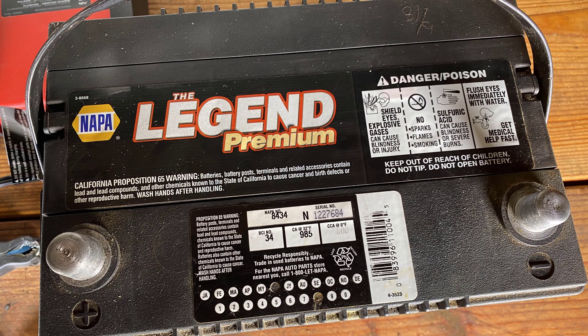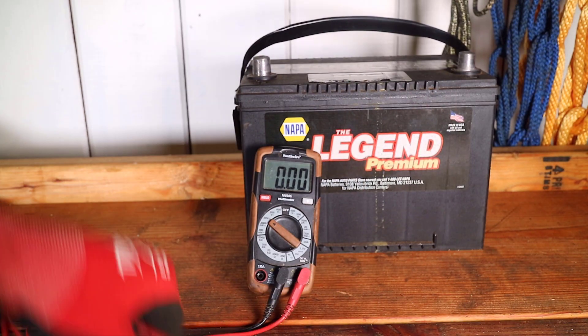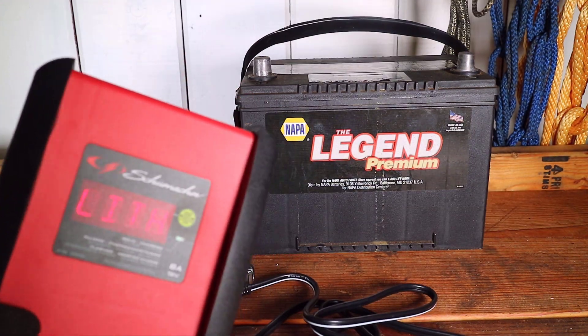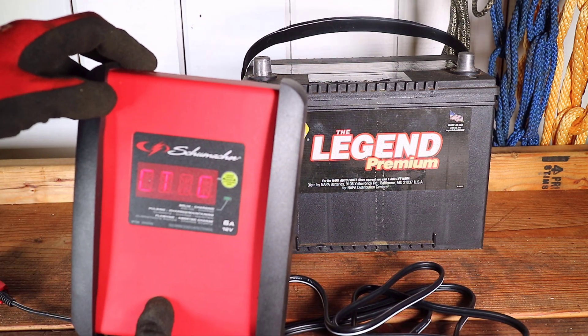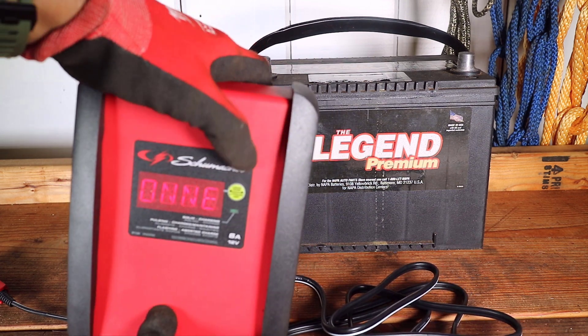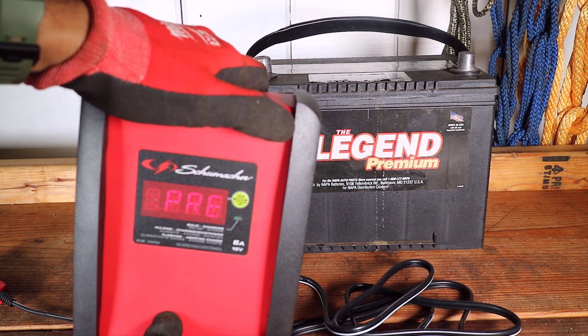While viewing the label, the battery only appears to be a few years old. In testing the battery we have a voltage of 9.89 volts. Although I do not have a battery load tester at this time, I do have a 12-volt battery charger. This charger is pretty simple and it offers both an option to charge lead acid and lithium batteries. For this battery I want to make sure lead acid is selected.